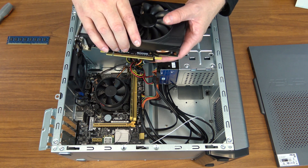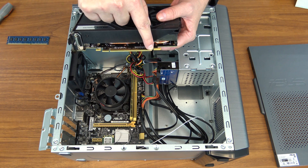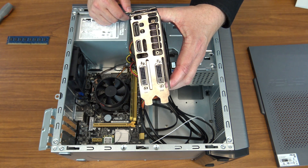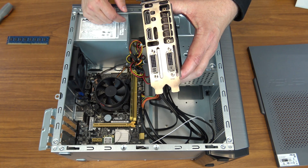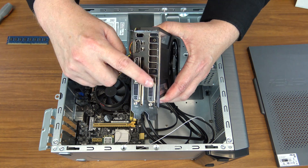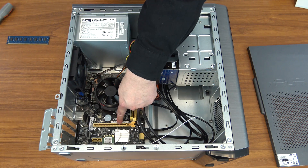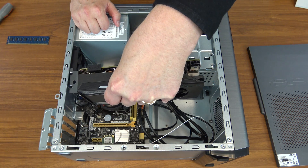Let me bring the video card over and talk about it for a minute. These along the bottom are what we call golden fingers — these are going to insert into that graphics card slot. There's a notch here and a notch here, and that notch goes here and here to give you an idea for alignment. On the back, we have four video ports on a GTX 960: two DVI ports, one HDMI port, and one DisplayPort, as well as a small vent. These three video ports are going to go into the top slot, and the vent and the additional port are going to go into the bottom slot.